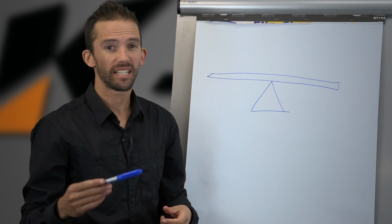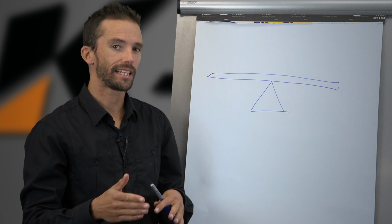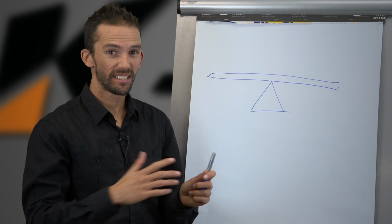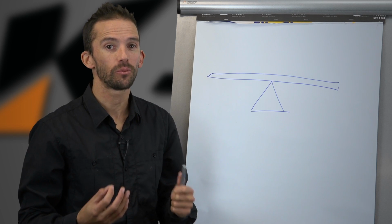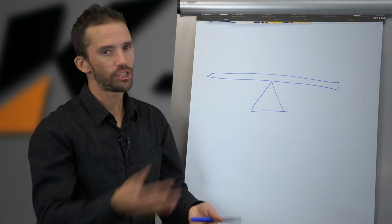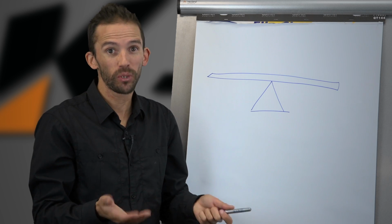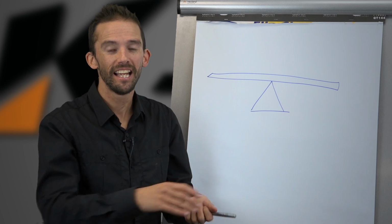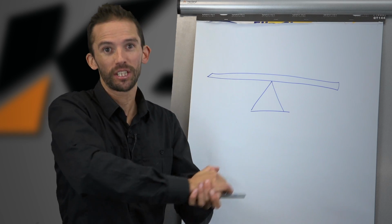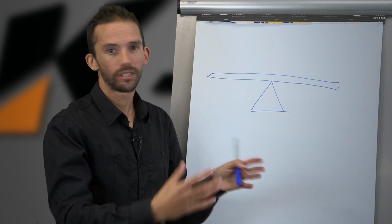The second question, and this is the important one that I think most people fail to ask, is the tyres that let go, are they skidding or are they twisting? And remember, in the last few weeks, we've gone over some of the signs that we can look for to ask the tyres that question. If the tyres are polished smooth with barely any grain on them and clearly haven't been doing any work at all, then it's pretty safe to say those tyres have been skidding, and the resolution for that is going to be put more weight on them in order to generate more friction, more heat, more grip. That's going to get more side load action out of that tyre.